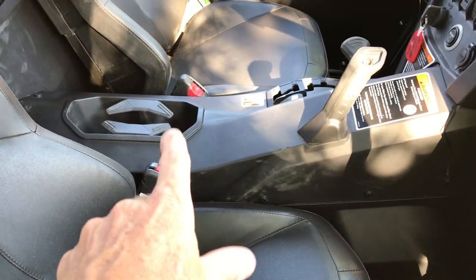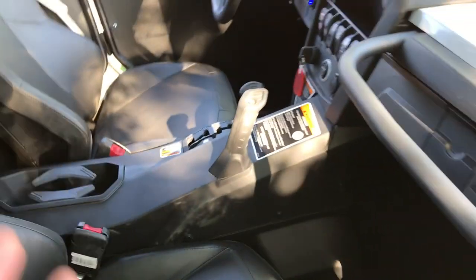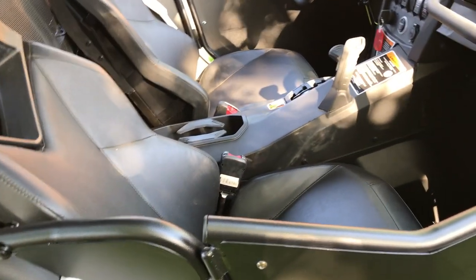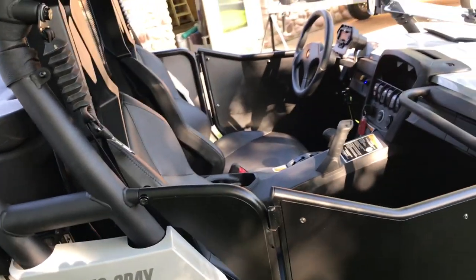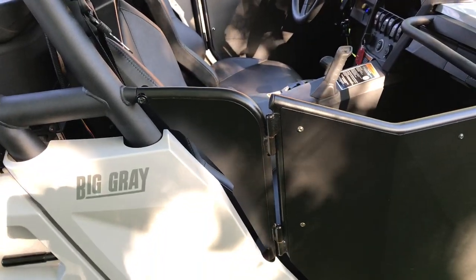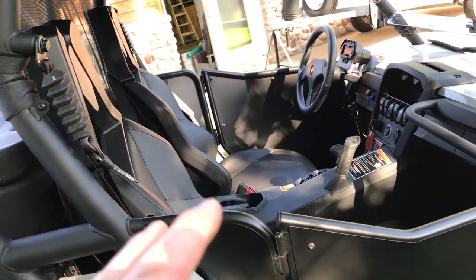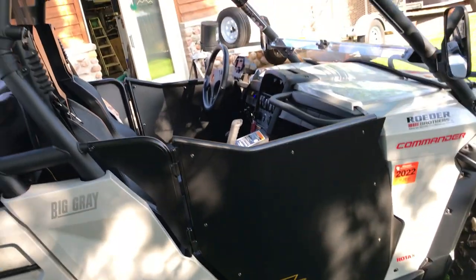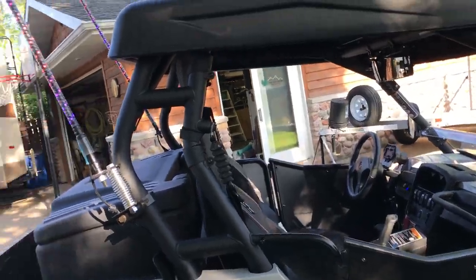On the other side I have the bypass for the granny gear. In low gear, it normally governs your speed, but with the bypass wire installed - about $19 to $29 off Amazon or eBay - you can go full speed in low gear. Just be mindful: don't abuse it or you'll wreck something.